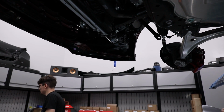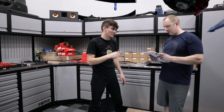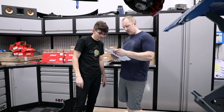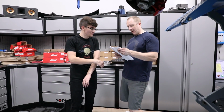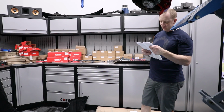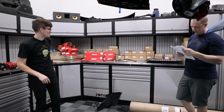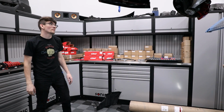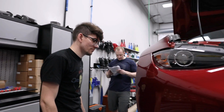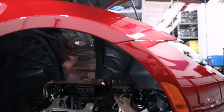All right, you got those loose. You ready to move it up? Let's see. Now we pop the radiator up top. Fan shroud is held in place by 4 tabs on the radiator. The upper tabs have latches to prevent the shrouds from being moved up. Pry these tabs open carefully, then push the shroud up to disengage it. Okay. Heads up, coming down. The bushings are not removable, so don't try to take them off. Is that what it says? Yeah.